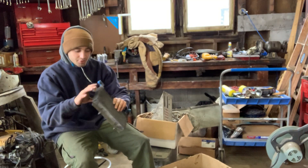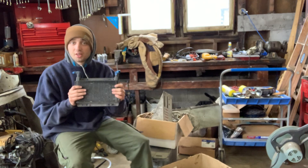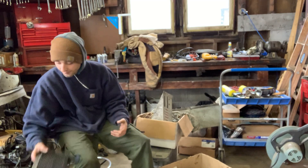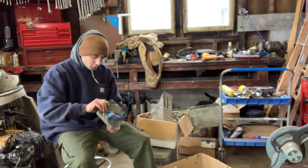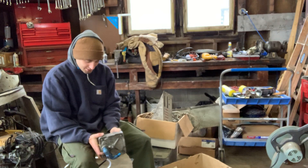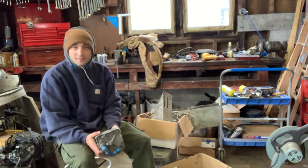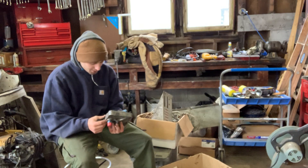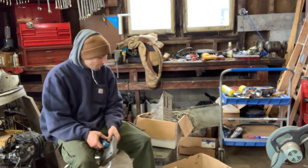Here's another one — a much bigger unit. This looks like all oil to me. I honestly have never seen one like this — maybe someone can tell me what it is. I don't see any radiator grill fins; it looks like another swirl pot that takes oil and coolant, but I really don't know. It's all aluminum, it's old, and it's super cool. Another oil cooler here — a newer style, maybe Setrab or something like that. Easy to mount anywhere, just an in and out. Nice to have all the cooling elements. This is called a tattletale oil filter — it's a flat filter to save space and you can tuck it anywhere. This would have been a secondary filter for extra filtration. Definitely a racing unit — Oberg makes it, made in the USA.